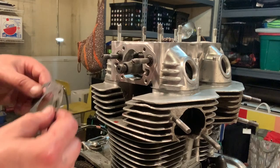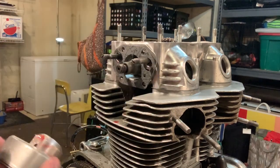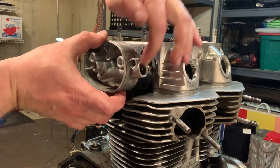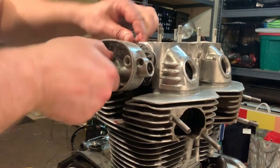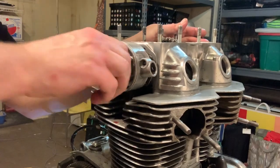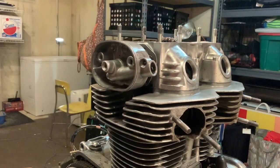All right, hopefully things go as smoothly on this side. I'm going to carefully make sure that we've got the right gasket oriented the right way. It is. I've lubed up the shaft on all of this. This is ready to go, so I'm going to position this. Remember, your input for your tach drive is pointing towards the front. I caught my gasket just a little bit, so I'm going to move that up. This thing should lift and push right into position. I've got one lobe popping up just a little bit.